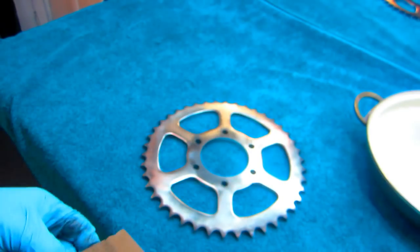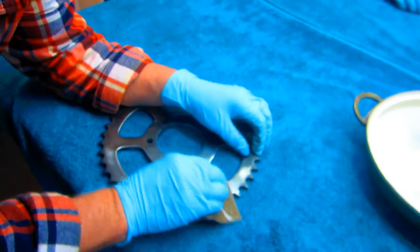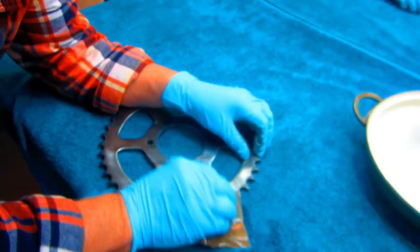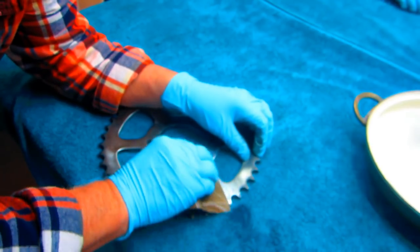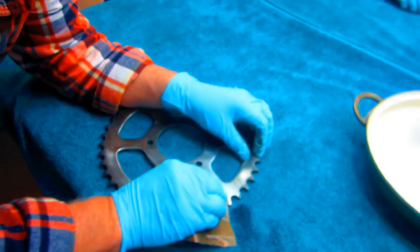Okay, and this is 600 grit. We'll see. Now, depending on how deep the scratches are, the key thing is never leave any plating on. If you leave any plating on at all, it just gives you a mottled look. It doesn't look good at all to me. But here's the thing: this part of the job takes some time.